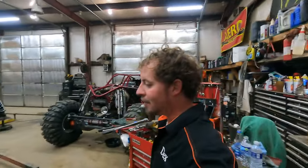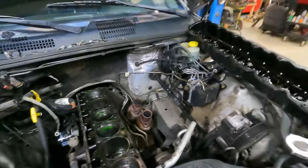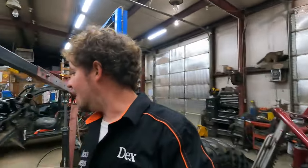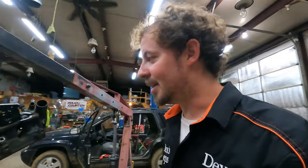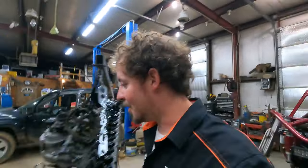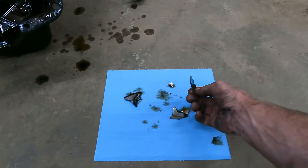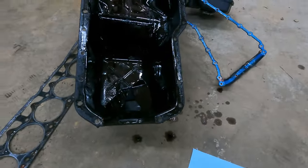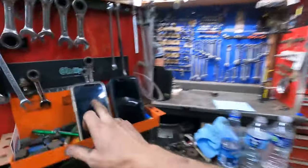I got the head pulled off. It's an OEM head gasket — you can tell by the stuff that won't come off. This motor's probably 200,000 miles. If it were mine, I'd be doing valve seals — that's normally where the 4.0 starts using oil. I'm not getting paid a dime for this job, just trying to help them out. Got the oil pan off, and that starts telling you where the noise is coming from.